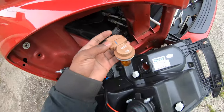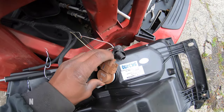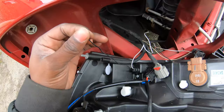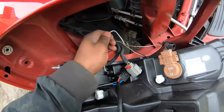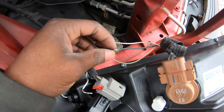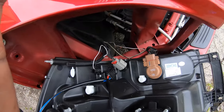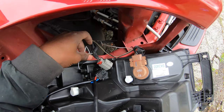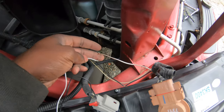Now we're going to put on the new one. Basically take off the old headlight and slap the new one in the same way. Now this is for your LEDs — you've got one that's the ground and this is the positive. The white is the positive, black is ground. Basically, you're going to link the black ground to the black ground. I do not recommend tying these wires together, but I'm going to do it for now. Same with the white — the white goes with the power core here.